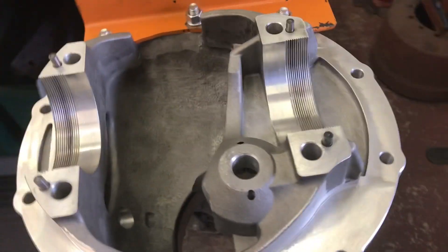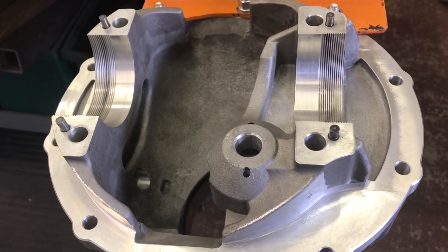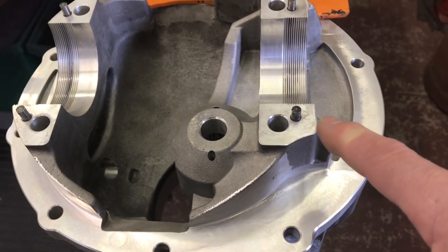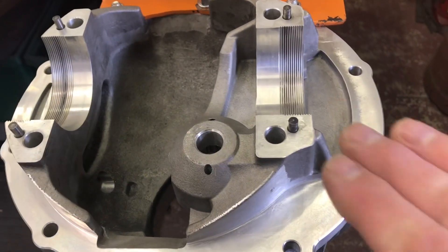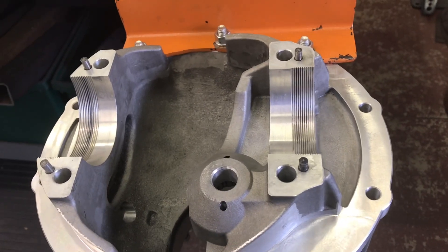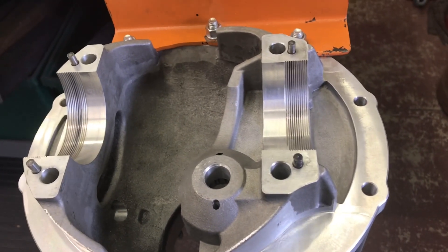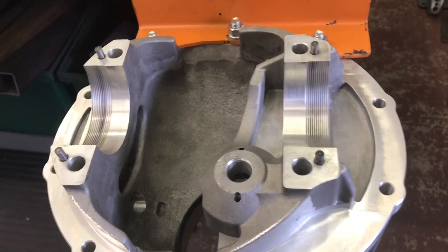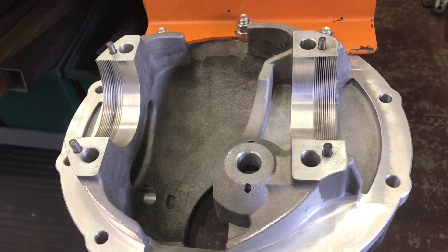The aluminum cases are nice — they're about 17 pounds lighter than the cast iron ones. The caps have pins which make removing them somewhat of a challenge. You don't just want to drive something in between there because you'll destroy it. Gently tap up on it and use your thinnest scraper. If one side gets a gap, tap on the other side with a rubber hammer so you don't hurt anything.